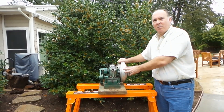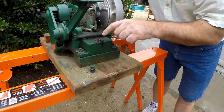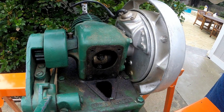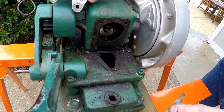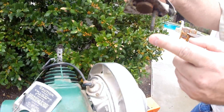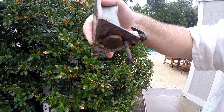At a closer inspection, we took out the gas tank fill plug and it's completely full of junk. We also took out the carburetor, and you can see on the inside it's still completely full of garbage. One of the biggest reasons it wasn't working is it's missing the check valve on the bottom of the inlet tube for the carburetor, so for sure it wasn't going to run.